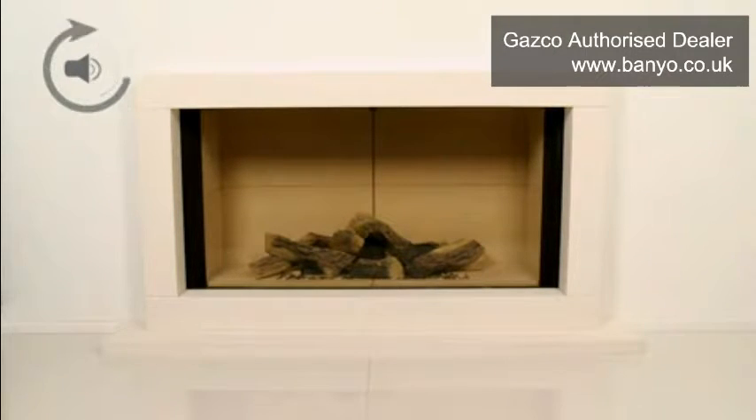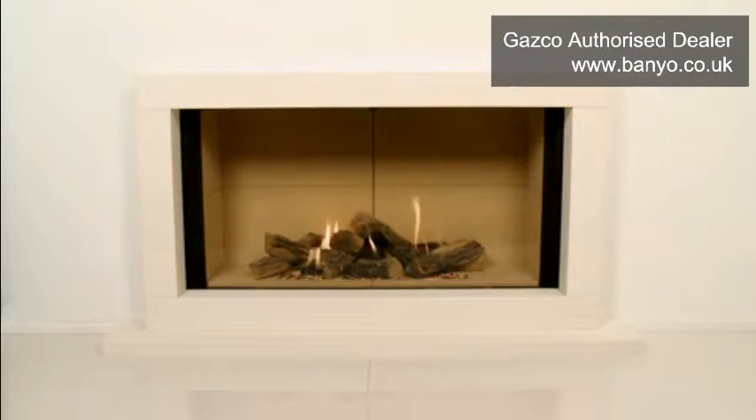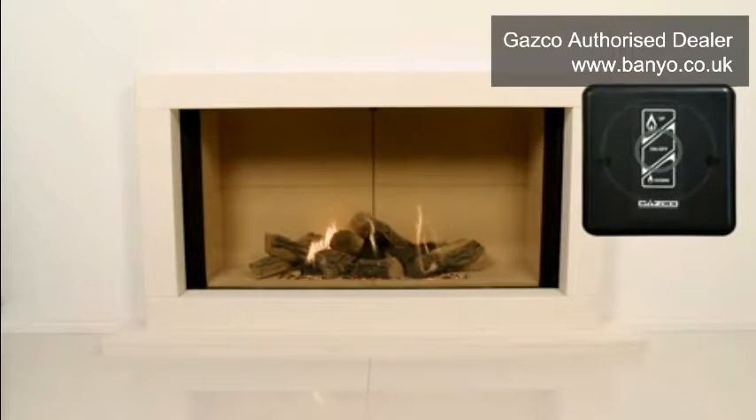You will hear the valve motor of your fire stop. Your fire should ignite within 5 seconds. The fuel bed should ignite directly into the high flame position, with an even spread of flames across the whole fire bed. If this sequence is not successful, or the fire extinguishes at any point in the ignition sequence or whilst burning, turn the appliance off by pressing the off button on the remote control or the on-off button on the touchpad.